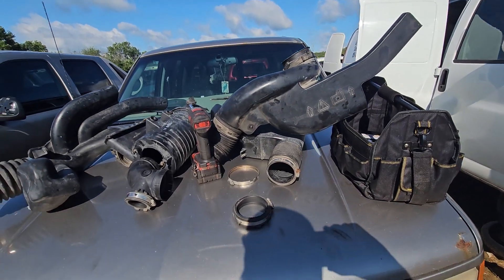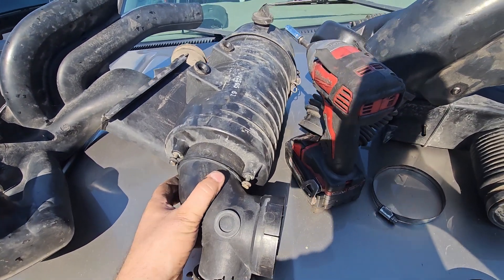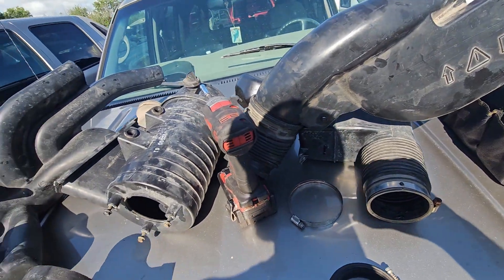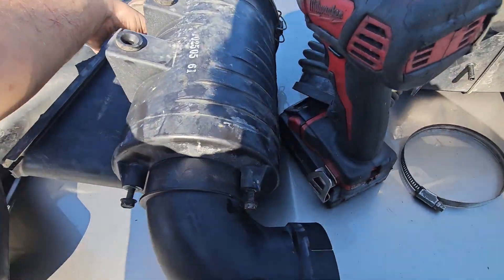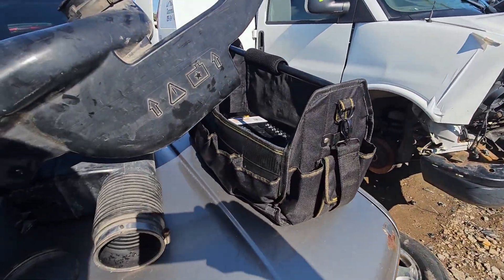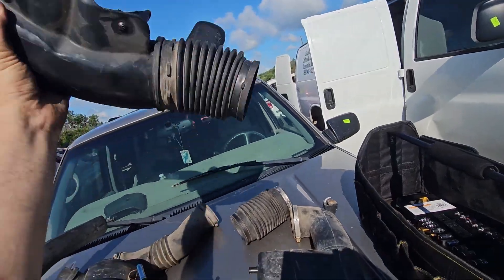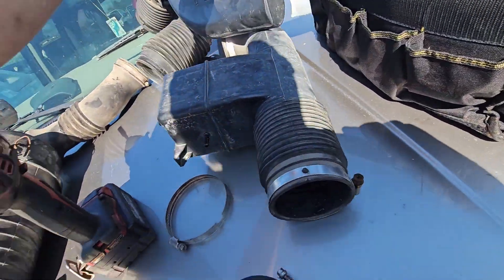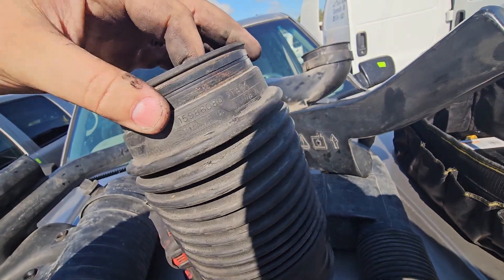This has probably gone too far but I'm having fun and that's what counts. This is the fourth-gen LS van airbox, and this is the thing that went on the mass airflow meter. All these other LS tubes fit this, so I don't really know that I need a 90-degree piece. This S-shaped tube is off that van right there. This is off the Tundra right there — you guys probably recognize this. This air silencer fits any LS, but I can't get that hose off on the left-hand side — they seem to be glued on.